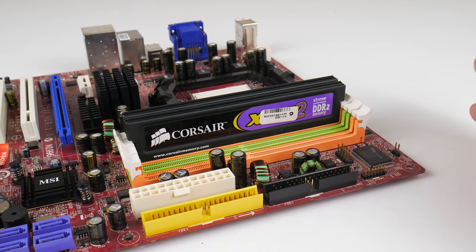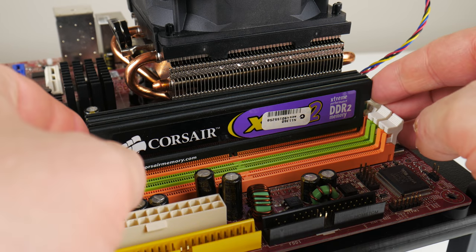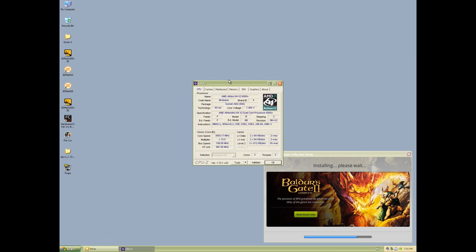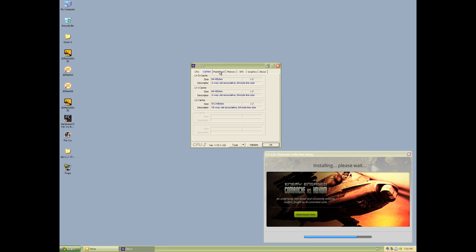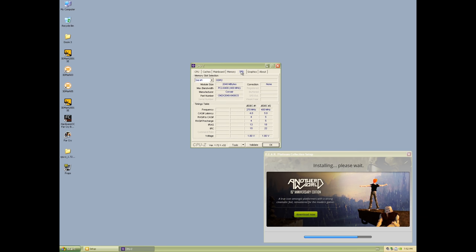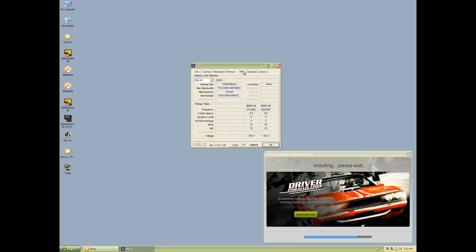For Windows XP, four gigabytes of RAM is what I like to go with. So here we have two RAM modules with two gigabytes each — these are DDR2 800 modules. Now the processor we're using today is interesting because it has an odd multiplier. The memory speed will be slightly below 400MHz — this is not a bug. It's just the nature of this processor using a multiplier of 15.5. So if you're using any tools to read the memory clock speed, don't be alarmed — it will be a little bit below 400MHz.